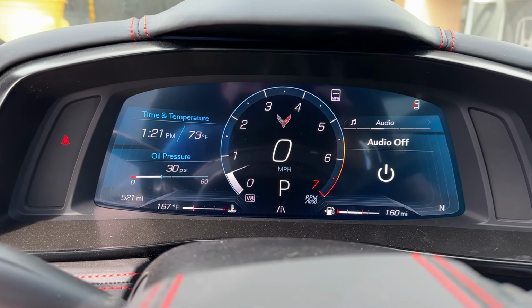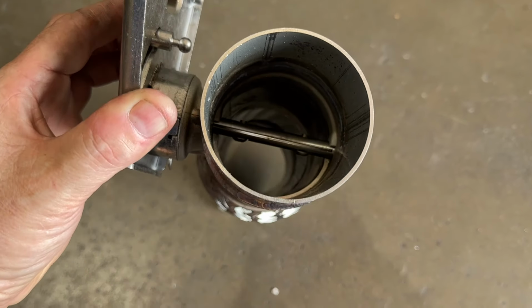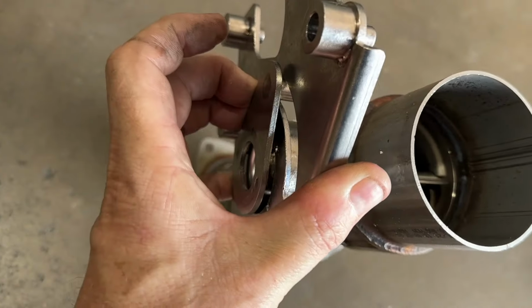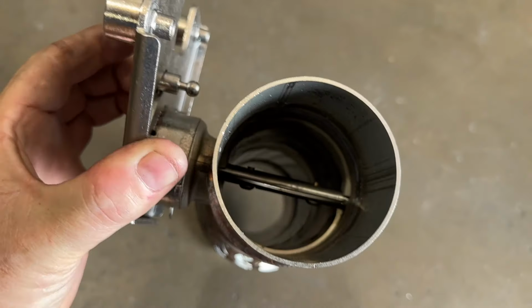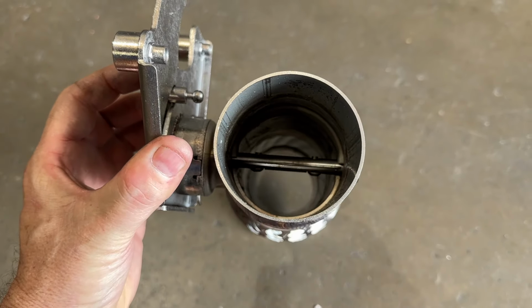And I think what it is, it's the springs in the, I think they call it the AFM valve. Essentially, it's a spring-loaded valve that helps combat that sound where it goes into four-cylinder mode. Four-cylinder mode, it almost sounds like a misfire. And if the spring tension isn't right, or the actual opening and closing of the valves, it's very sensitive, it flips the code. Mine started to have a transmission issue.